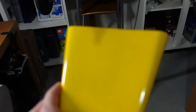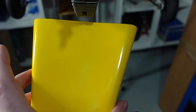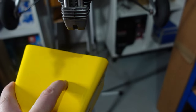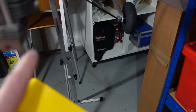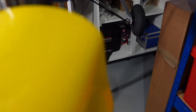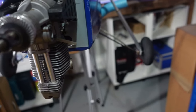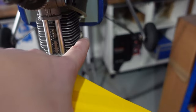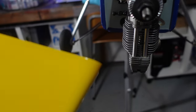The initial offering-up of the cowl shows the main cylinder head is massively in the way, so I've got to cut that out of the bottom of the cowl. I'll put some masking tape on it, mark it up and use my Dremel with a disc cutter to cut it out. I'm going to be fairly generous with the hole — slightly oversized — because it aids cooling and you need access. Since it's on the bottom of the cowl you won't really see it, and it just makes life a lot easier.